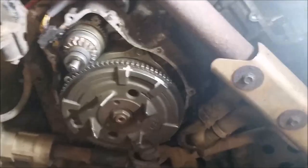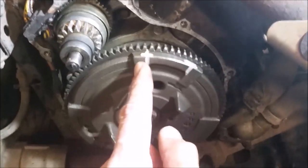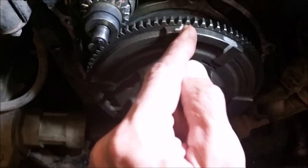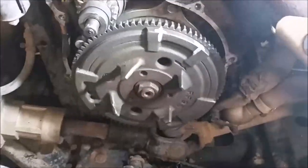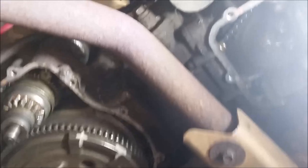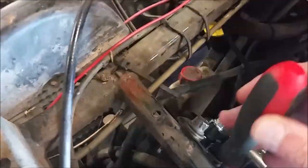There's another way you can do that. There is an access hole here. Put the flashlight in there — see that little white mark? There are marks on the flywheel; somebody already tried to adjust the timing. There's a T there. With your cover on and you're looking at the hole, there's a mark on the cover. You line that up with that T and you're at top dead center. When you're at top dead center, these marks up here should be straight up on top. I like to go one step further — grab a screwdriver, put it in the spark plug hole, and move it up and down just to make sure the piston is actually where it needs to be.